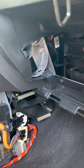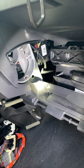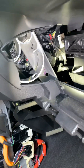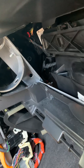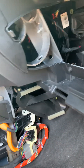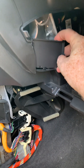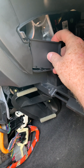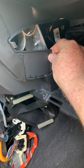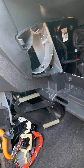The tricky part about this one is there are actually two actuators on this side. You can see one right there that's not too bad to get to — it's the one for the floor and the defrost in the front. That's not the one we're after. We're after that one right down there that's a little harder to get to. One of the hardest things is you can't get a direct shot on any of those screws. There was a trim piece right here, and a few people drilled a hole right there to get a shot to the screw. But if you just remove that piece — which is covered by the glove box and nobody will see it — you can pull it out and get your hand in there quite a bit to start screws and see what you're doing. That helped quite a bit.